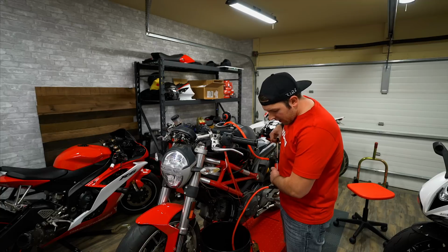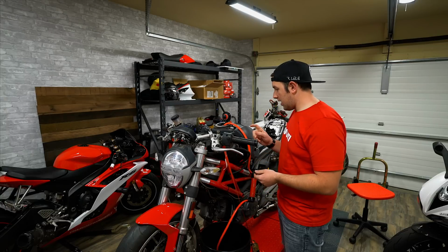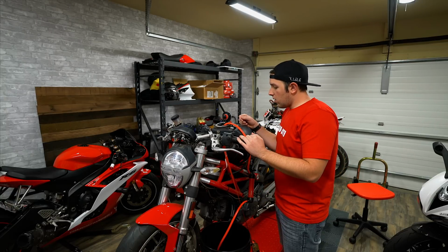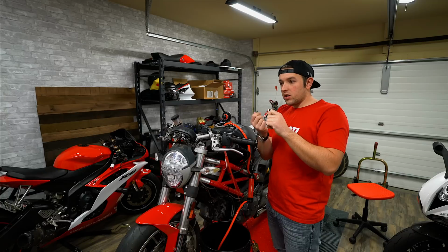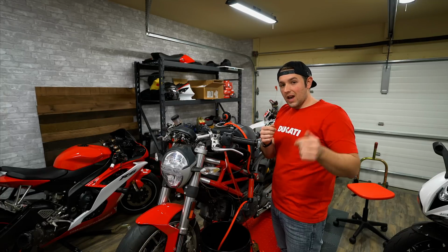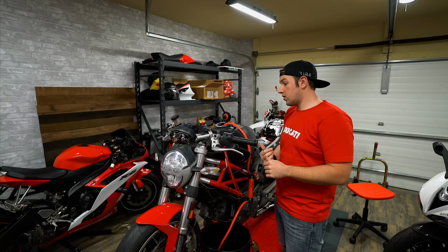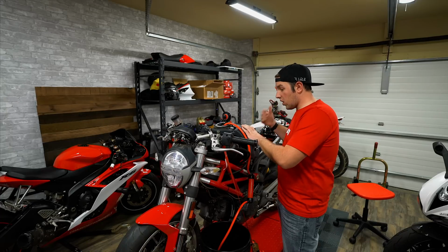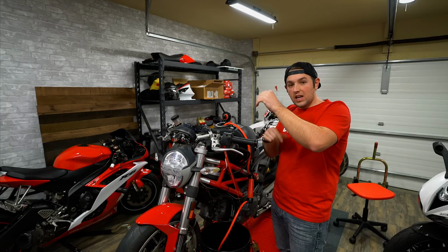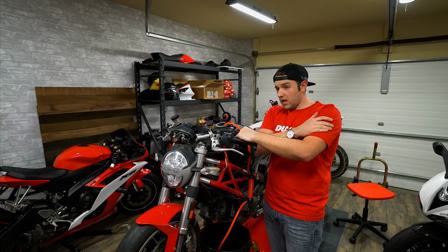So I'm doing everything like it says to do, and there's just not a lot of gas getting into the hose. So what I think I'm gonna do is disconnect the tank like I did last time, unscrew the fuel pump a little bit and let gas come out, and then I'll know there's no gas in there, because I really don't want to drill into that thing with gas in it. So I'm gonna get the gas tank taken off totally, and then just leak it out through the fuel pump, and then we'll start drilling then.